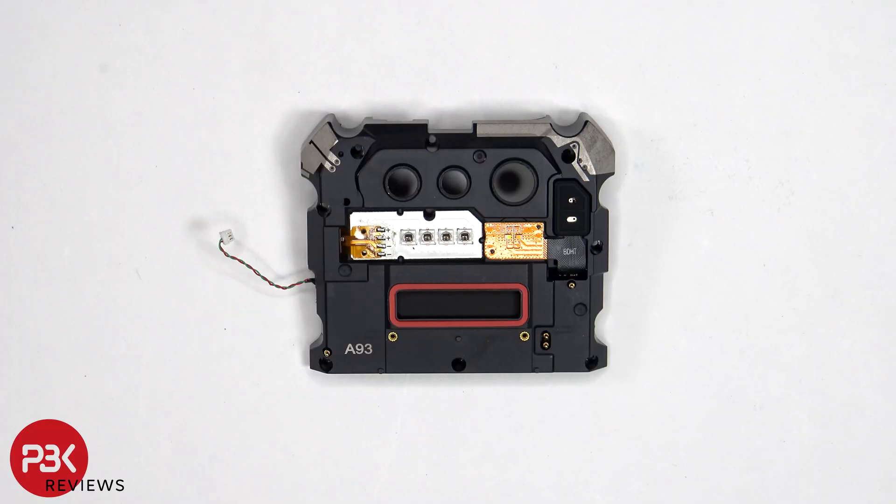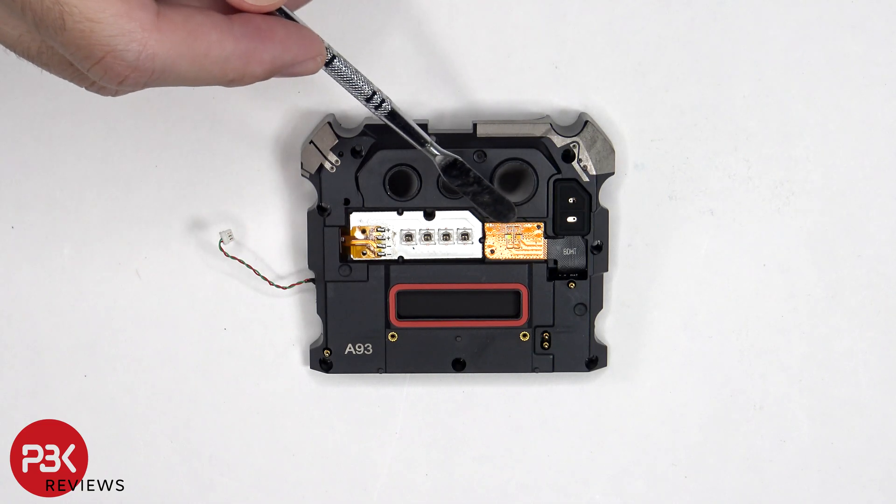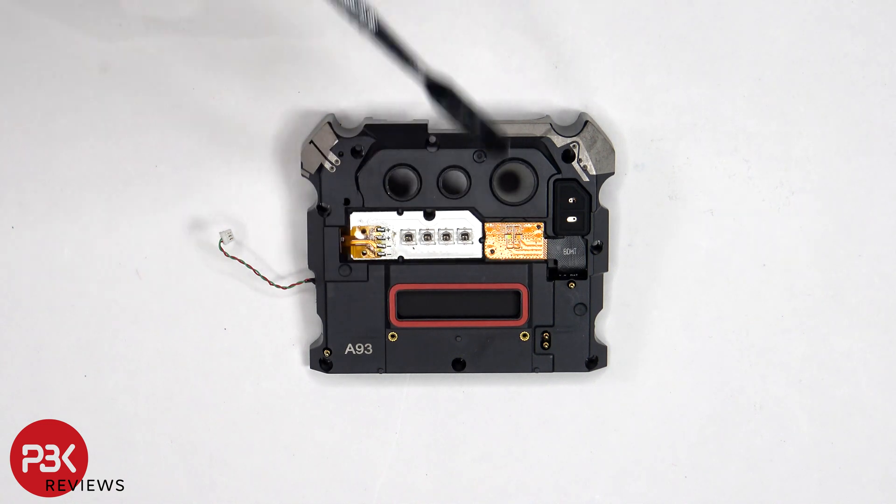Taking a closer look at the top plastic motherboard cover, we can see these antenna lines drawn in light gray color, the dual microphones covered by a rubber gasket, the dual LED flash, the night vision lights, as well as a rubber gasket around the speaker opening.